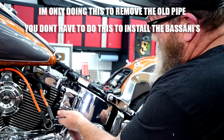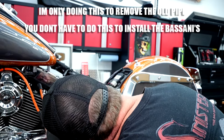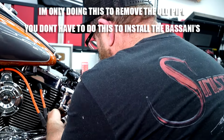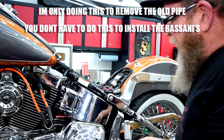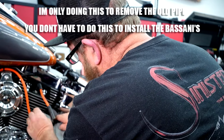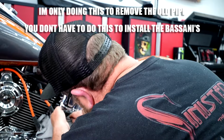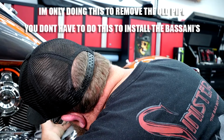But down here on the bottom of this chrome piece, you're going to have an 8mm screw. So we're going to get down here, we're going to loosen this screw, hopefully get it out by hand. We don't want to drop it down in the transmission. I'm going to grab a towel and put over this, because I know me, big clumsy fingers, I'll end up dropping that stupid screw. So if it falls, it'll fall on that towel now. And get in there with our 8 and take this little screw out.